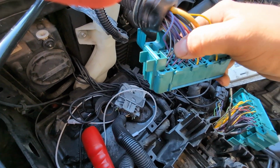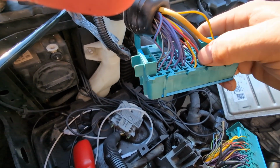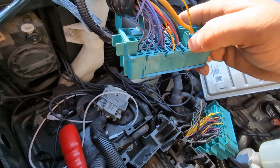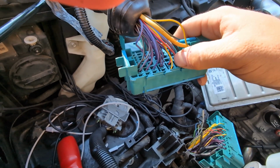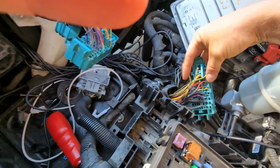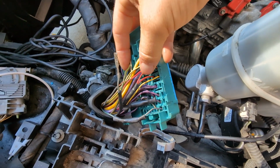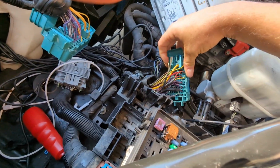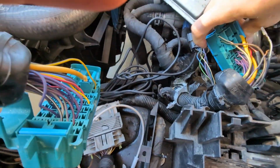The gray wire is right there. Make sure it's good. Ground, anything has to be matched up. Now, if you have a power in a different spot, same thing. The red wires are your battery powers. So if you have extra reds like we do here, we have 3 reds, then you're gonna splice one of the reds to another red wire, okay? Then you just look over everything else.